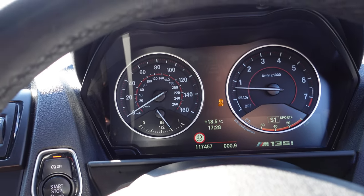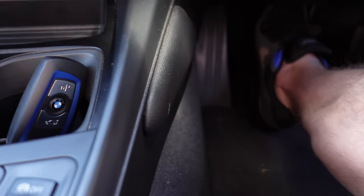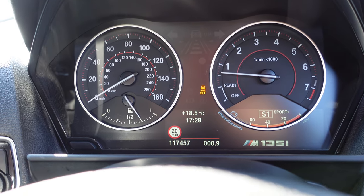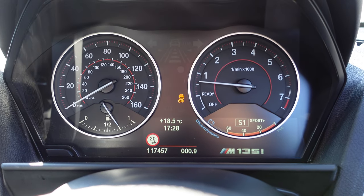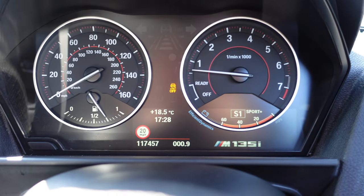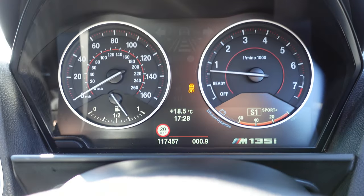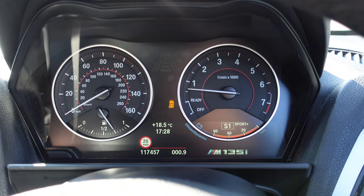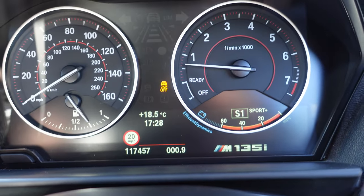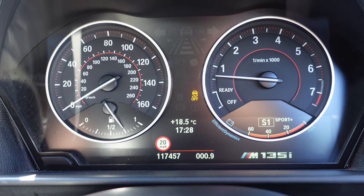You're going to want to push your foot all the way down on the brake. Then press the accelerator all the way down until it clicks — all the way down past the threshold. Hold your brakes all the way down so the wheels don't spin, hold onto your steering wheel, then press the pedal down and you'll see 'launch control active' come up on your dash.